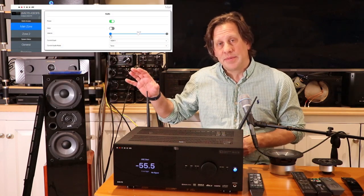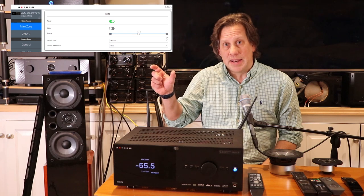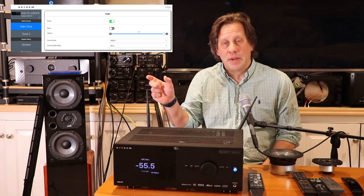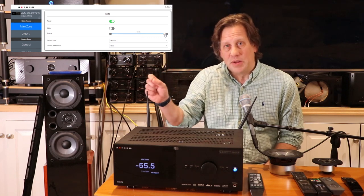The Anthem Arc Genesis wants to control the volume, but I can override it. The best way to override it is with the mobile app because it doesn't do the jump that caused the speaker to blow. In the web interface, if you're not precisely on the raise/lower volume button, it will jump to that volume on the bar — and if you're just left of the plus button it will go to maximum volume.